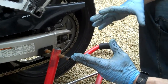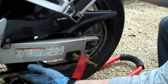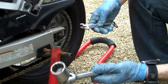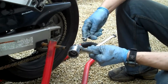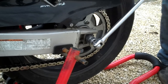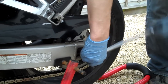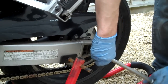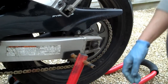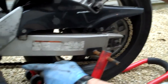Chain adjustment is pretty straightforward. On a Bandit you need a big 24mm socket and bar, plus a 12mm and 10mm to adjust the adjusters. Just loosen the wheel off. The torque setting on a wheel is normally around 90 to 100 foot-pound, but I personally feel that much more than about 60 foot-pound starts to crush the wheel bearings. Do what your manual says. When you adjust the chain, it must not be tighter than one and a half inches of up-and-down movement at the centre point between the front and rear sprockets.